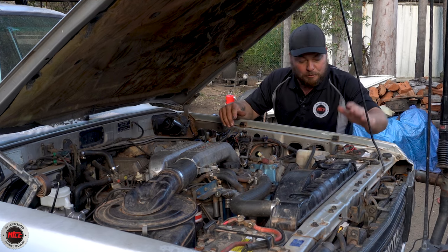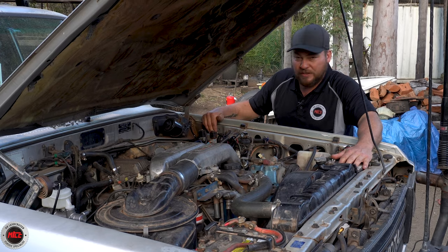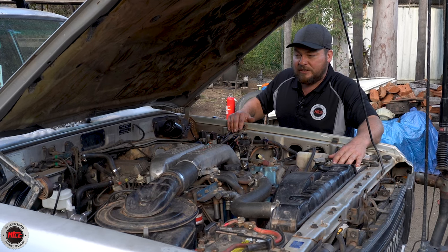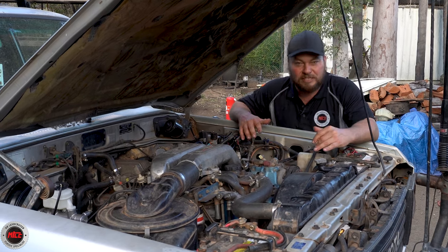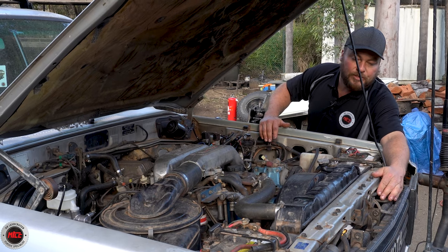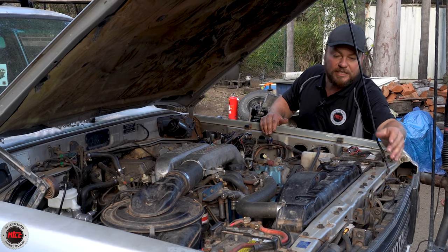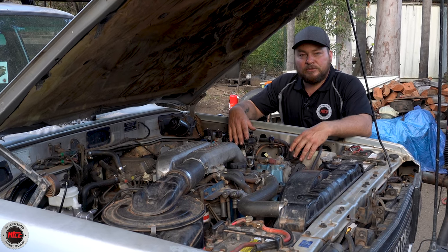We've got dual batteries in here, a must have for a touring rig, nice and simple. You've got the ARB compressor just tucked away in here, some diff breathers, stuff like that. Other than that, there's not a lot going on. I will say one thing, Tristan's into his 60s, right? So he's got a few of them. He's got a later auto as well, and he's nicked the auto transmission coolers out of the square headlight one, which doesn't quite fit. He's made it work by cutting out a few bits there just to keep that auto gearbox nice and cool. Definitely an awesome upgrade there.